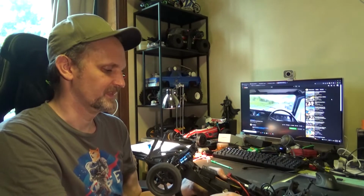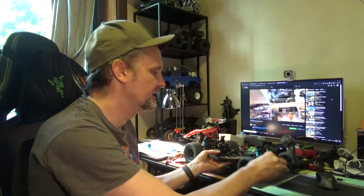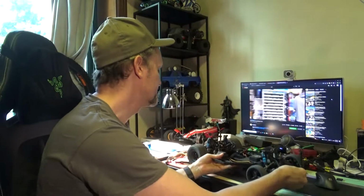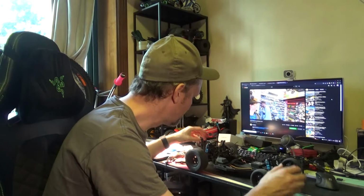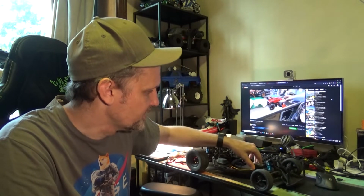And that's what's happening. But as far as suspension goes, as far as general design, I like the design of these arms up front. There's a nice droop to the car when you set it down. It uses about half the suspension on the front and about a quarter of the suspension on the back, just the weight of the car. This with no battery in it. So I do like that.